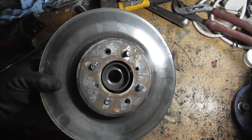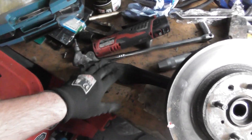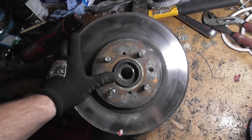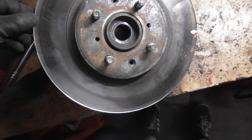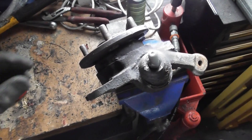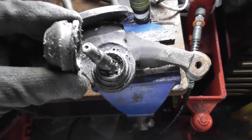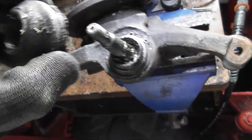With those off, the discs are free to come. These are the CRX VT hubs and they've come already with the 282mm discs with the Integra Type R calipers, so it's quite a nice upgrade. I'll probably change the discs and pads because it's a cheap thing to do and you need to rely on them. Now I've got the hub itself with the ball joint. Just remove the dust cover — it's obviously completely shot — and sometimes you have to clip out this little ring, but either way that's out.